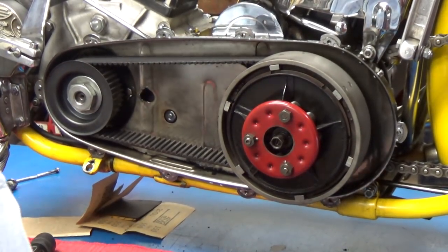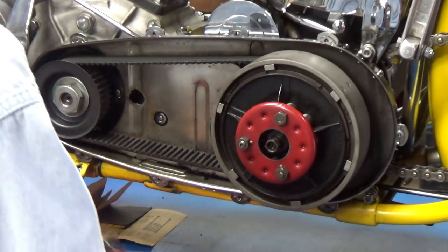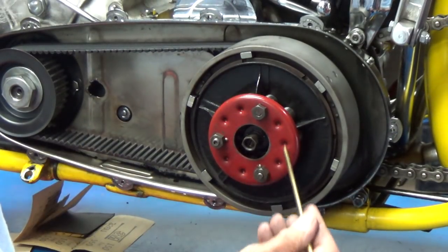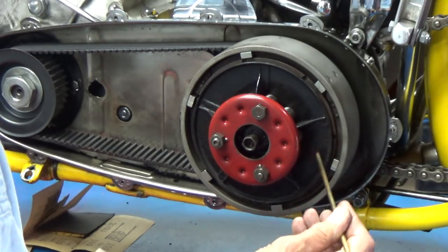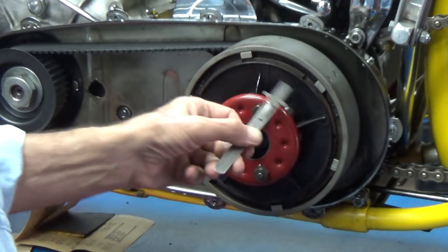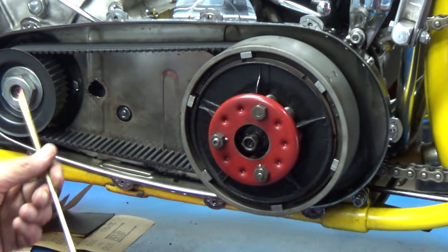Put the cover over there out of the way. Here's the clutch. First thing we want to do is take a measurement. This collar here is referred to as the pressure plate. This plate here is referred to as the releasing disc. Now if I do the adjustment on this little scale here I can see where the adjustment is now — it was already working well. So let's just use that as a reference for later.